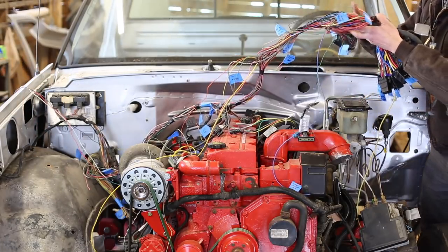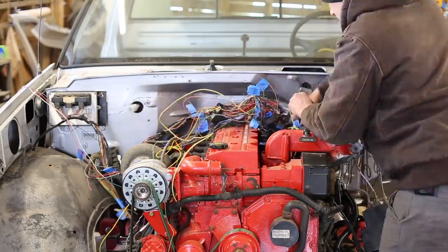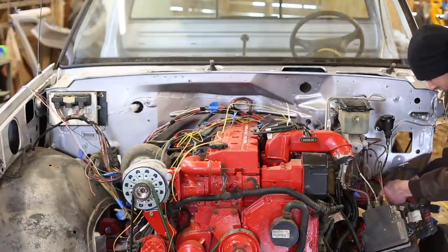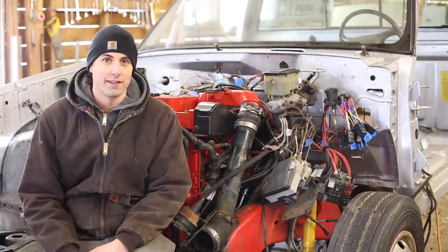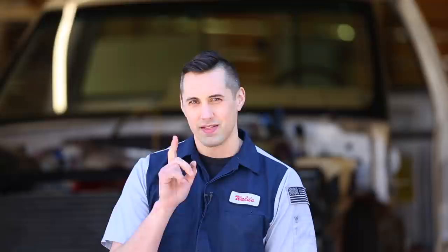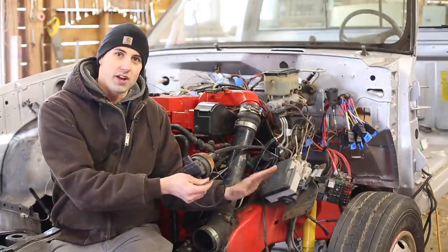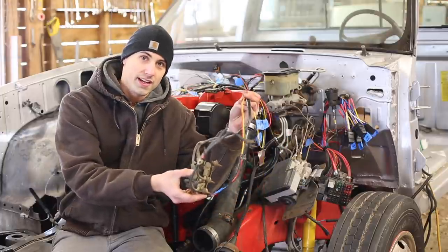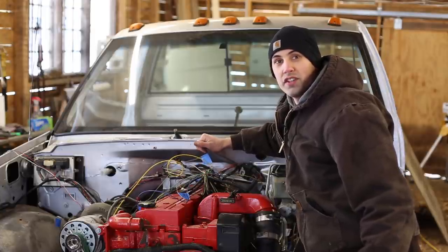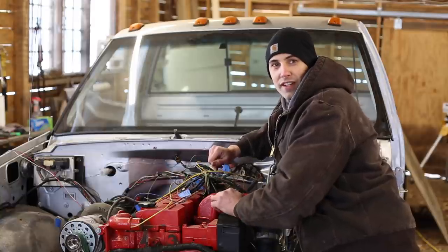The tricky part might be snaking this big mess of wires through here. I got it in like a pro! Let's talk about some of the connections I have not made yet — these generally fall into the category of connections that were difficult or impossible to do while the harness was outside of the vehicle. This thingy right here — that's a technical term — is the thing that controls the vacuum for the cruise control, and it's going to be mounted on the driver's side wheel liner. Also to be mounted on the wheel liner are the relays for the air intake heaters. There are also wires going to the transmission — a reverse switch wire and a twisted pair for the vehicle speed sensor.